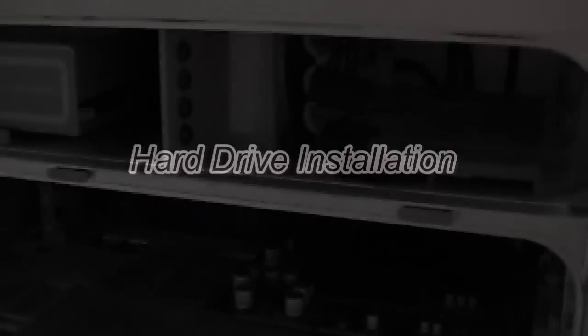For the hard drive installation, you're actually provided with screws, and you may not even realize it. These four that are sticking here are actually for you to remove so that you can put them in your hard drive and slide it in there, which I'll show you here in just a sec. Those just attach into the holes on the sides of the hard drives like this.